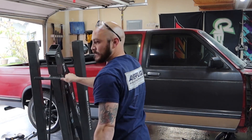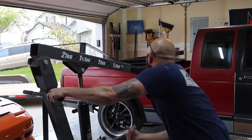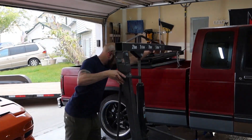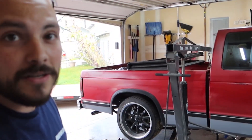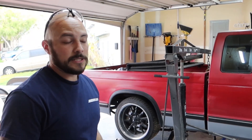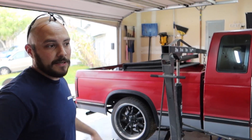So we're going to remove the bed and change out the pump. I was hoping I didn't need this for a very long time. Now I got to be careful because my jack stands were placed when I had the bed on, so I'm just going to tilt it up as much as I can and pay attention to make sure it doesn't start leaning back. If so, I'll put a jack under the rear end.